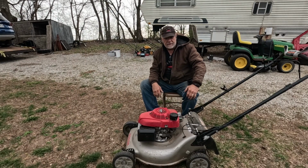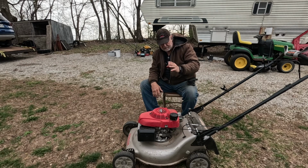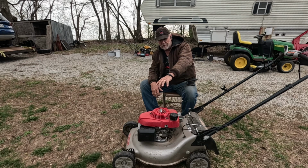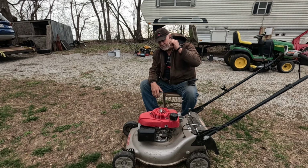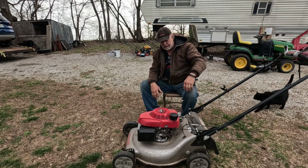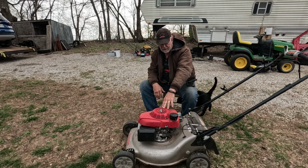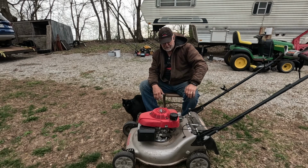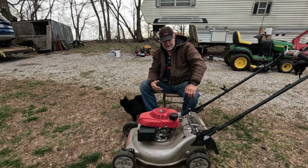Well, I think I'll wrap up this episode on the Honda. Just a quick rundown. I don't think I showed you all of the choke stuff, because initially I had taken some brake clean and washed off that mechanism and thought I had it working good, but then I still pulled the cover, and when I actuated that, got the rest of it freed up and moving good, so the choke closes all the way.